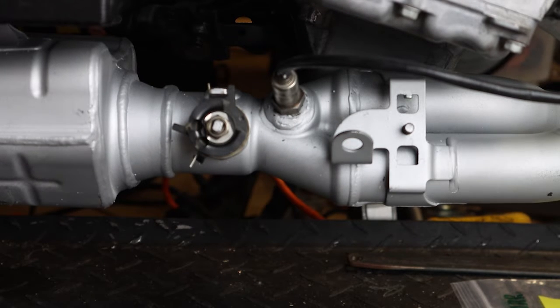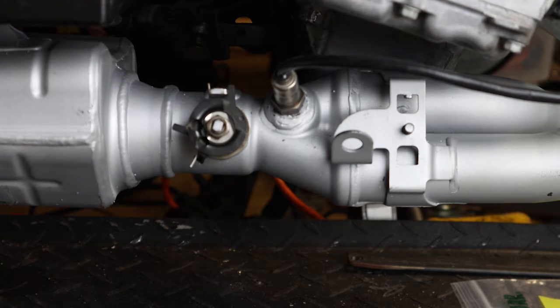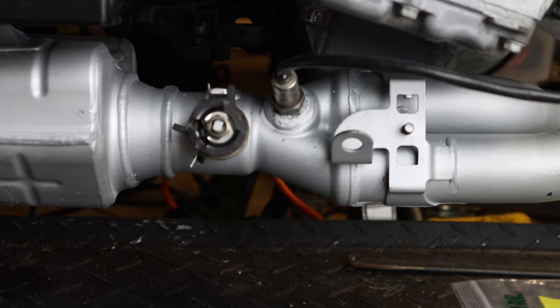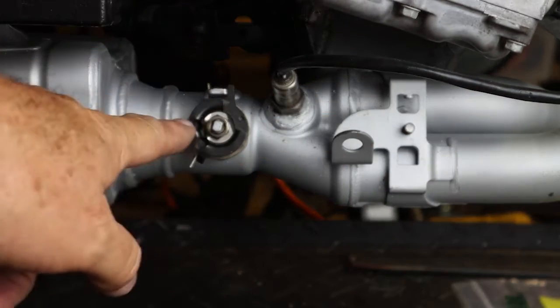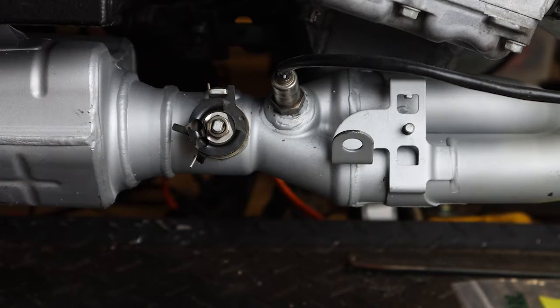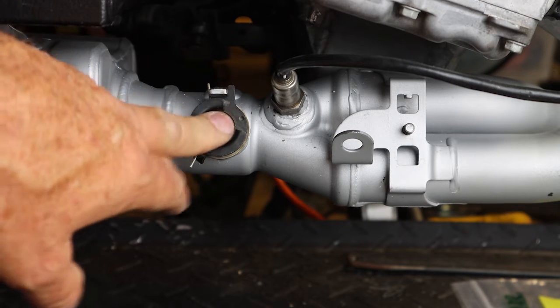So what we're going to do now is get the exhaust control valve servo, which mounts up top in where the engine compartment is, and there's a set of brackets that will mount that on. Then there's a series of cables with adjusters, and there's a bracket here that holds that. I'm going to show you how to mount that, and then when we get power onto the bike, we're going to adjust those adjusters so that this butterfly valve is going to operate properly.